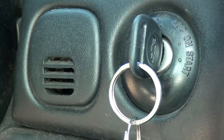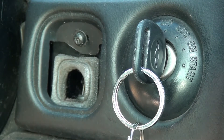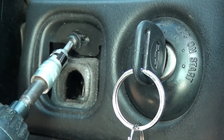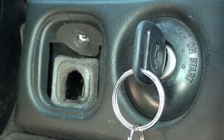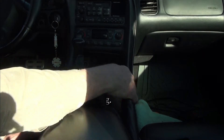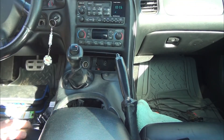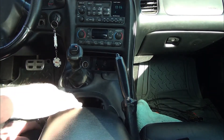There's another screw. This is the air temperature sensor next to the key — the inside air temperature sensor. Yes, that just pops off and flies at you; that's what it's designed to do. But if you're real careful with it, you won't break it. And there's another screw right there. Now the console actually should be loose — I can pull up on it to break it loose. But I need to put the handbrake all the way up, push on the brake, and put the shift control lever to its furthest position that I can get it in, and sort of lift on this.